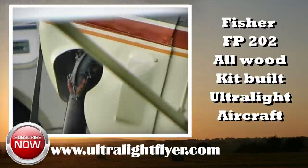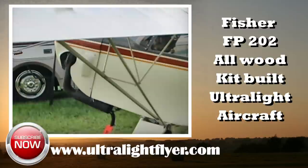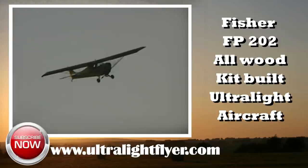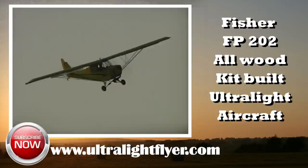The craft uses all wood geodetic construction covered in standard aircraft covering materials. Standard features include an enclosed cockpit with removable side panels, large pneumatic tires, a steerable tail wheel, 5-gallon fuel tank, fiberglass cowl and full-scale plans. The standard kit takes about 500 hours to build while the quick build kit saves about 300 hours of build time.